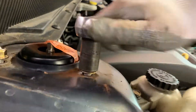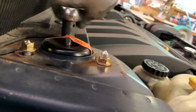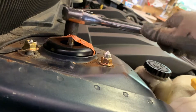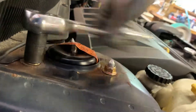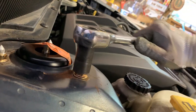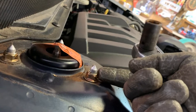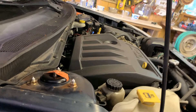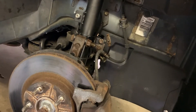These are 15 millimeter and I believe they have some kind of gasket or locking feature on the inside, because when I get to a certain point I can't hand tighten them anymore. That makes sense to me. On a Dodge Stratus I did, I ended up stripping some of these out because now I can't get the nuts off them, so I'm leaving that one alone — it doesn't make any noise and everything's tight on it. Since then I've been doing this technique just so I don't need to replace anything again.